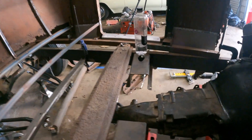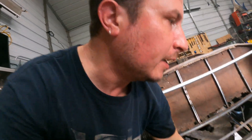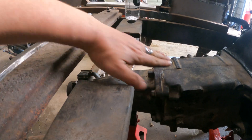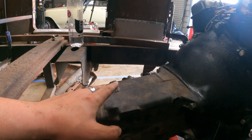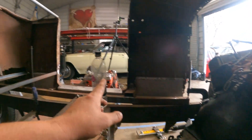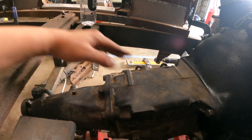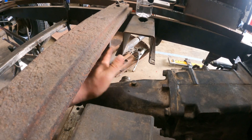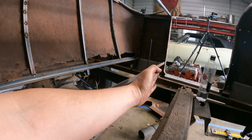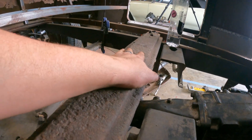One of the important things to note is just how much shorter this transmission is than that one over there. Just eyeballing this — this is a stock Model A crossmember that was cut before I got the frame, but you can see why. This bell housing is much shorter than the automatic bell housing, so I'm going to lose a lot less floor space to this thing. Also, this has a flat top, so basically when I'm done, this is going to go right under my floor, which is great.